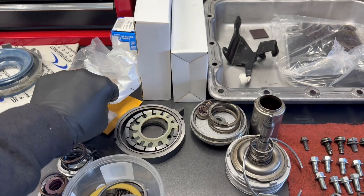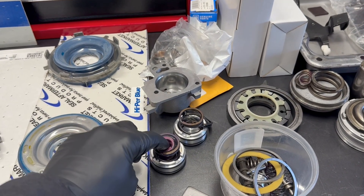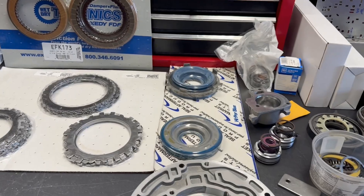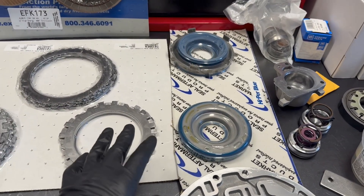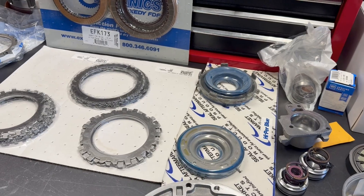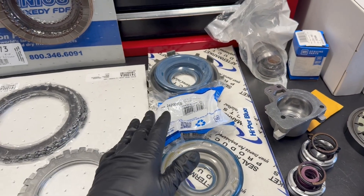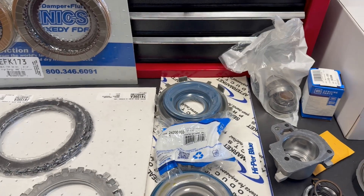Alright: overhaul kit, Transgo 4696 plate, wiring harness, manual lever position sensor, new rotor guide with new pump vanes, rotor and slide kit — all OEM. Here are the pinless accumulators for the 1-2 and 3-4 positions, brand new bushing kit, new vehicle speed sensor. They didn't replace the old speed sensor and they installed the extension housing upside down, so the speed sensor was also upside down — total amateur hour. This was a 96 unit, and any time you're working on a 700R4 or 4L60E up through 1996, you need to install a bonded piston set in place of the aluminum pistons in the forward drum.